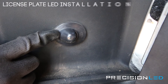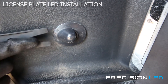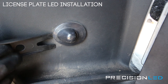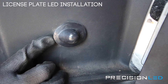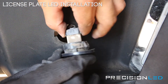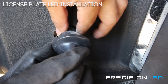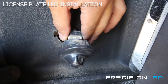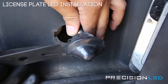We're looking now at the license plate light on our Ford F-250. We're going to be using one of the ends of the crowbar shape tool. There's an indentation here that you're inserting from, and you're using it to push down one of the clips on the side and then pulling out. When you have one side up, you can just jiggle it loose — pushing on the tab and forcing the entire assembly over so you can push out one side. If you do have access from behind the bumper you could push these in yourself, but from the exterior you're going to be using this tool.